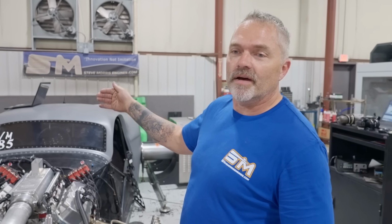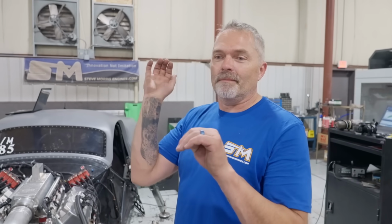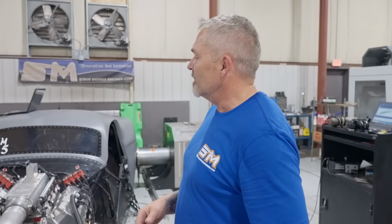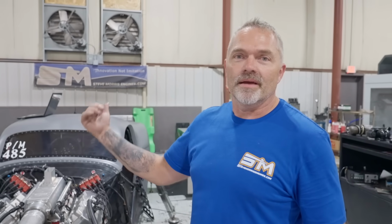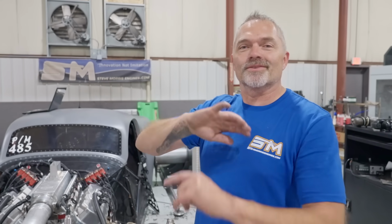What we're noticing in the drive shaft curve is that it is at 85. Now, this is only because it's in high gear. You go to whack instantaneous horsepower, the dyno is trying to catch it, but it just isn't right. It's just not the way to do it. So that thing in high gear is just driving through the converter. It flashes the converter. So it's 7,000 drive shaft RPM and 8,500 engine RPM. The dyno isn't quick enough to catch it. It's a total cluster.